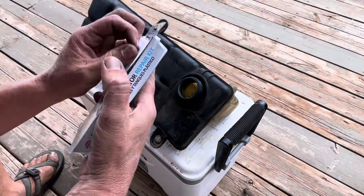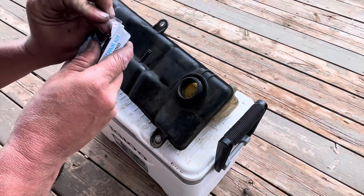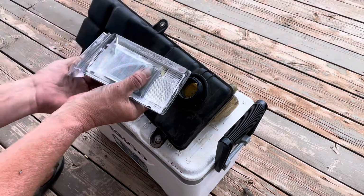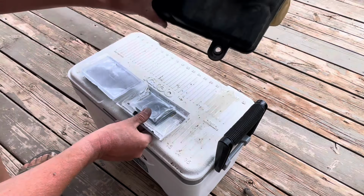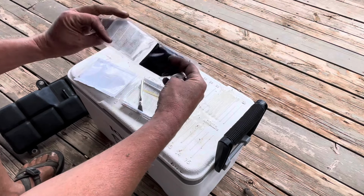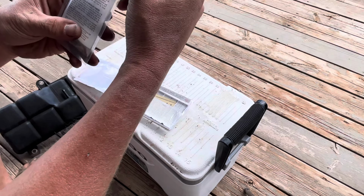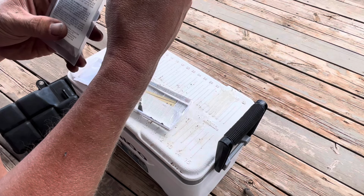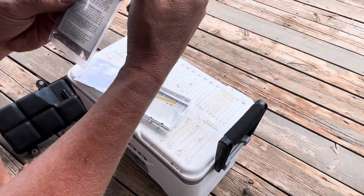If you guys remember when I did the Metro, you couldn't see quite as well, but I did give you step-by-step instructions on how they said to do it. So hopefully here, you'll be able to see it a little bit better. So let's take this off first. If I remember correctly, you mix these epoxies up and you have like 5 to 10 minutes. Firmly apply pressure to lower half of pouch to burst through center seam. Knead entire pouch until product is thoroughly mixed. Carefully cut open corner of pouch at the dotted line. Squeeze adhesive onto area to be repaired.